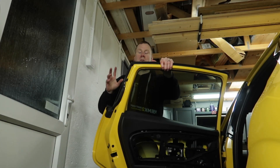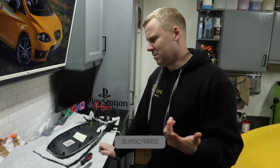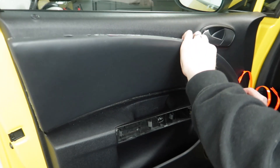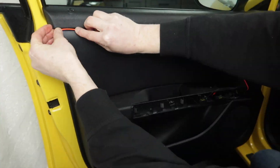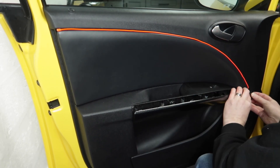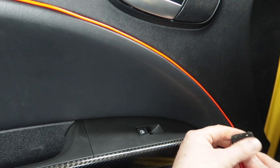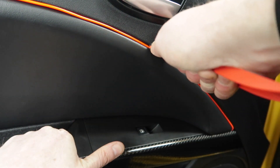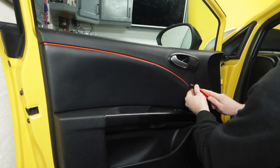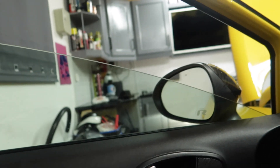I'll let you in on a little secret — I'm in the middle of doing another modification on the car, which explains why there's a hole here and a mess over here. Make sure you hit subscribe so you don't miss that video. Pop the insert of the door card back on and now you're looking for the best fit for this LED rope light along the edge of the door card. Once you find it and you've gathered any excess through the hole at the side of the door card and into the bottom of the switch, just tuck it all in nice and neat. Use a plastic trim removal tool with a bit of fabric over the end to gently push the rest of the LED rope light into the trim firmly. You can use a little bit of double-sided tape to hold the ends in place. A quick check to make sure the electric window switch still works — and our job is complete.